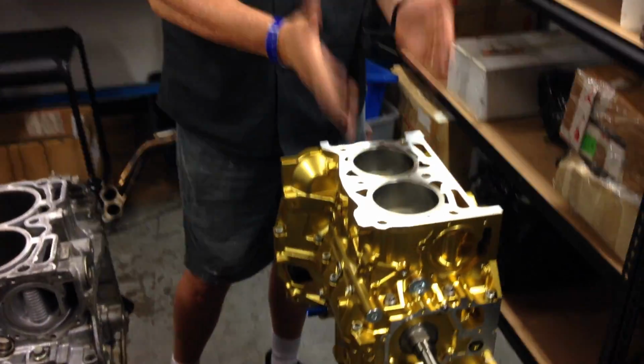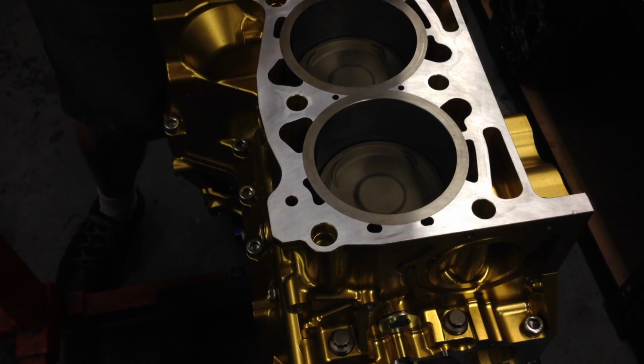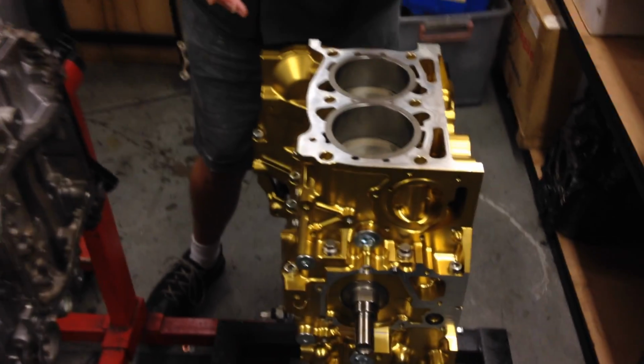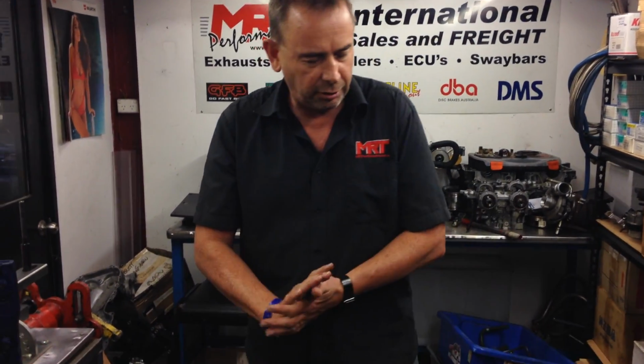Whereas on the billet block assembly, which I can't show you because the liner and the pistons are in place, underneath there where the liner is seated is a lot more parent material, which effectively gives a hell of a lot more reliable future peace of mind in knowing that the liner will not sit down or relieve itself into the block assembly at all. But let's just look at some of the other areas.